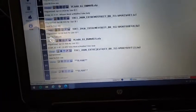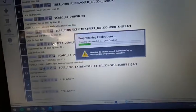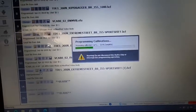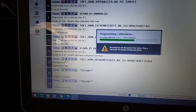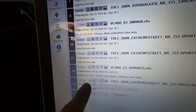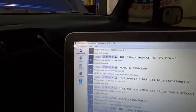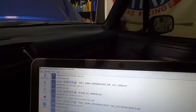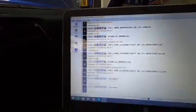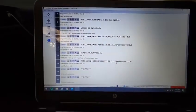At this point you're not done yet. The button right next to it says 'Program this calibration to the memory,' so go ahead and do that and you'll see the programming calibrations screen come up. If you get six new revisions or six new tunes from a different tuner, instead of doing this one by one, you can do the same procedure with each file — press the file button, browse and open all those files in the positions you desire, then hit the program button on the left side and that will download every single new tune to the chip. Once successfully programmed, it will show confirmation on the bottom screen.